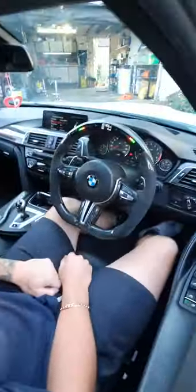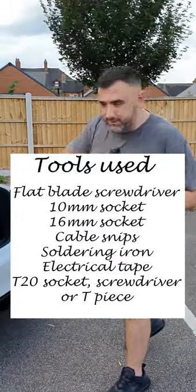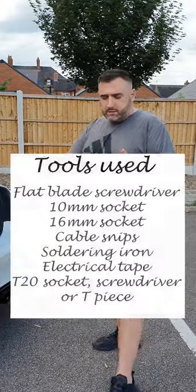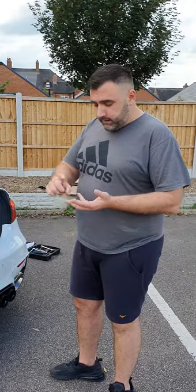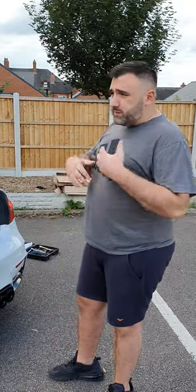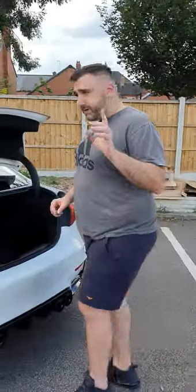The first thing you've got to do when you're swapping your steering wheel is disconnect the battery — two reasons. One, because you may get an airbag error if you remove the airbag whilst the battery is still connected, which you've then got to get coded out. And two, to remove any residual charge from any of the electrical circuits, capacitors and stuff that may activate the airbag. People do worry about airbags, and I'll go on to that in a second.